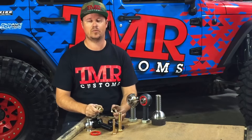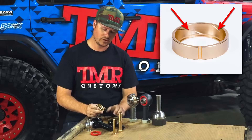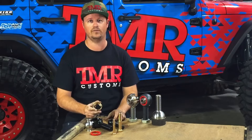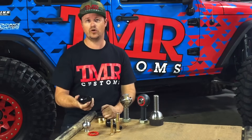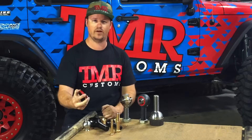The races are made from a proprietary blend of bronze, actually created in a foundry only 10 minutes from our shop. You can see we've got a quad-directional grease groove ring there, as well as a ring for the life seal, which keeps elements and debris from penetrating inside the joint. If the Lifetime Heim wears out, you can simply buy a master rebuild kit which includes new races and seals. If you break the body of the joint, we'll replace it — that's what makes this lifetime. You always retain the body, the bulk, and the spanner nut.